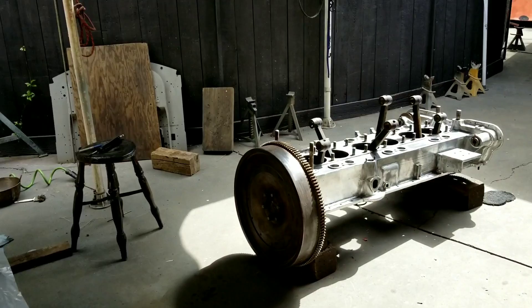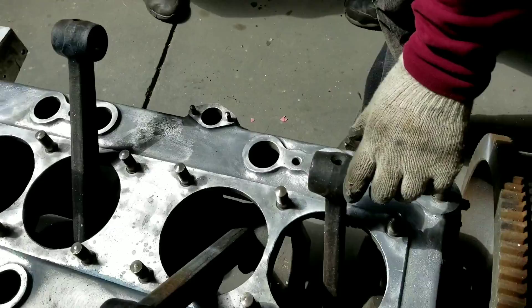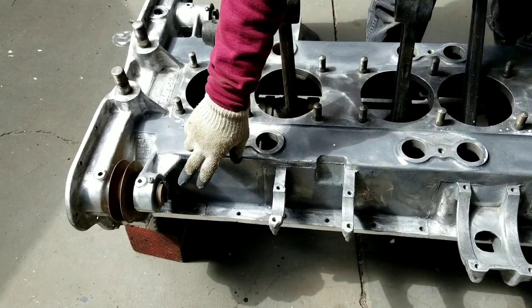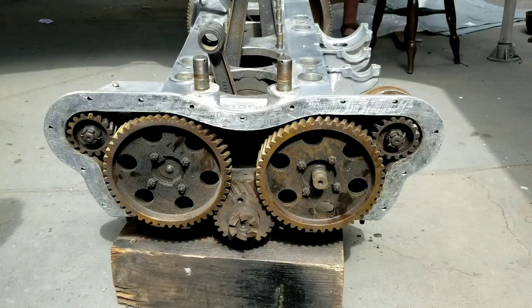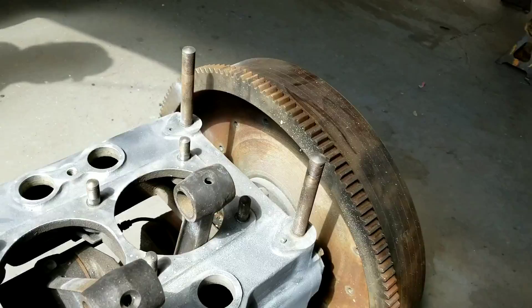Andres is the expert on this block — get in here and tell them. Look at that flywheel! This is out of a 1928 aluminum block. These are the big rods — it's all sandcast. There goes the generator; we're going to install an alternator. The water pump attaches to this shaft, that's for the belt. Timing gear in front, bronze bearings. It looks dirty now but if it looks big, it's because it is big.